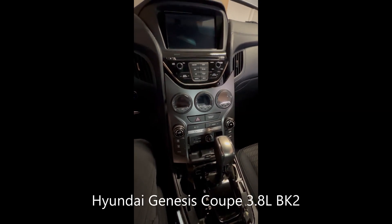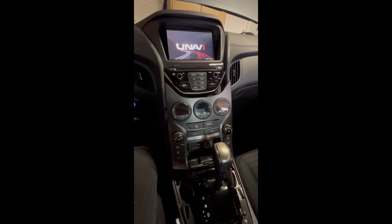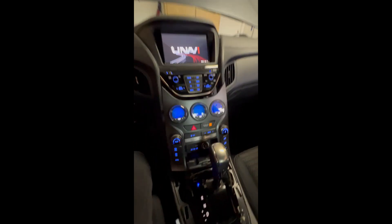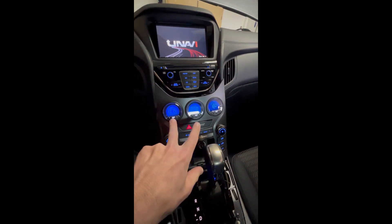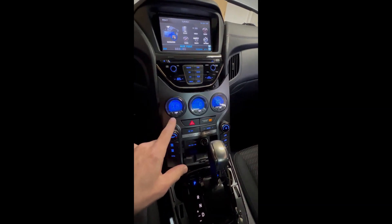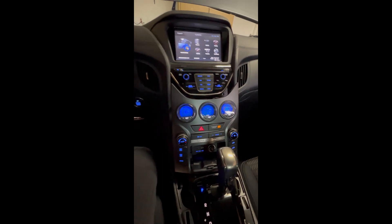I have a 3.8 model and I recently installed a turbo on it, and I'm also going to convert it to E85. I added additional gauges to match — since these two gauges with the turbo installed, the torque and fuel efficiency gauges meant nothing at all after the turbo. I also have some other gauges over here.